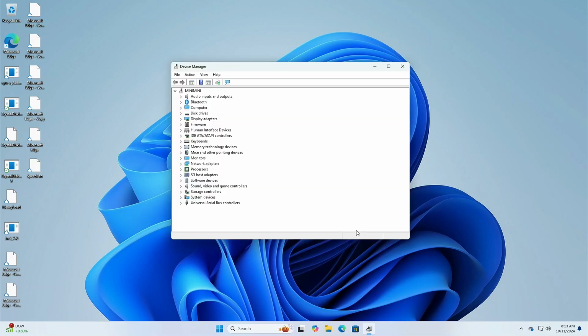All right, I did some tests with Kilowatt. Just plugged in, no power on, it draws 0.3 watts. On sleep, it's 1 watt. Average idle is around 14 watts. And then when I did a heavy load, it got up to an average around 26 watts. Definitely less than the other units. I mean, this is a processor that only has a TDP of 15 watts, so it would draw a lot less juice. And of course, you have a 45 watt power supply.